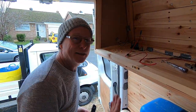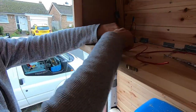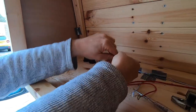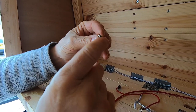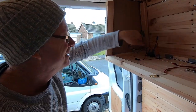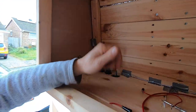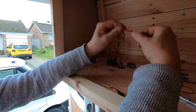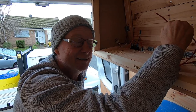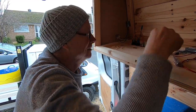I've fitted a bank of switches underneath the cupboard so that Rebecca can charge her phone and go on her laptop when she's laying in bed — all that nice cosy stuff. Now here's the dilemma: the back of the switches have got this inline fuse. I can't see what rating it is; all I can see is that it says 240 volts, which is a bit odd. So for that reason I'm simply going to cut this off, use a wire connector to join the wires together, and the other end of the power cable will go to our main fuse box where we can fit a fuse that we know the rating of. If the fuse does blow, we know Rebecca is going to have a spare fuse.